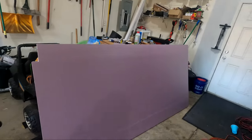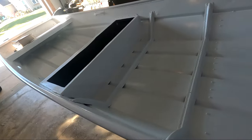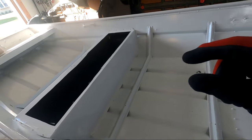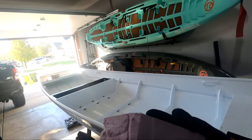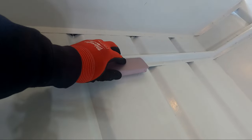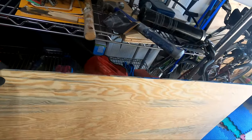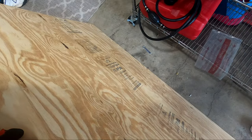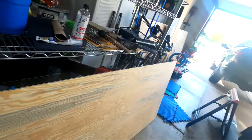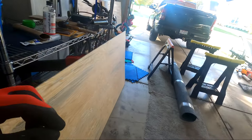I picked up an eight-foot foam board. I measured the ribs before I went and bought it — the ribs are just a hair over an inch. I cut a little piece just to size it out; it sits on this lip, really close to one inch. For the flooring, I did go thin — this is 11/32nd, so a little bit bigger than quarter inch, smaller than half inch. I'm really trying to keep the weight down on the boat, and with enough support, the thickness of the plywood shouldn't really matter.